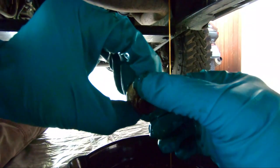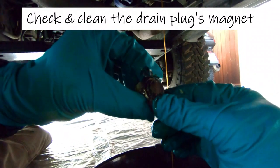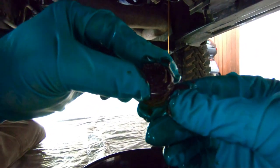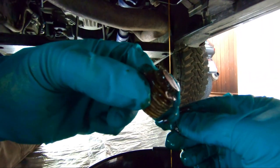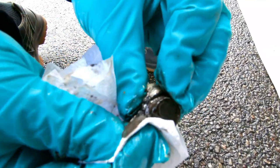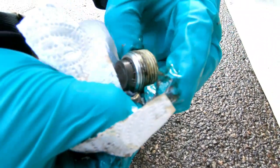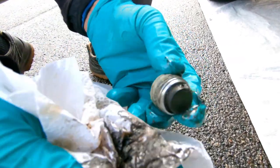While the oil is draining, you can clean the small metal particles stuck on the magnet of the drain plug. The size and amount of the metal particles can give you an indication about your transfer case health. This magnet is here to collect the tiny metallic parts that come from the use of the car, so it's absolutely normal to have those metallic flakes on it. It will also attract bigger parts that may be broken, such as a gear tooth. By cleaning and checking what there is on this magnet, you may be able to prevent a huge breakdown.